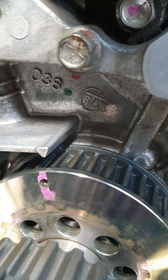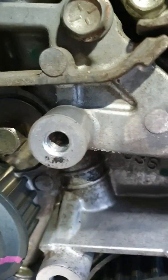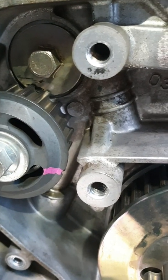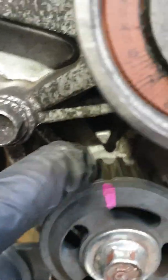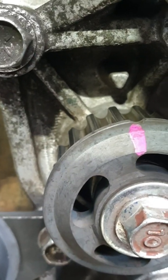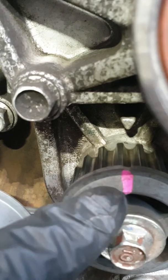The crankshaft is in the corner there. This car has two timing belts — the small one comes behind, so you can line up this one here. The small one is for the oil pump belt. The top one — you can see the mark here and here — that's for the small belt. So just line it up, and then this is the tensioner here, and the mark is just that one.